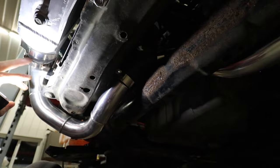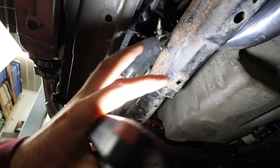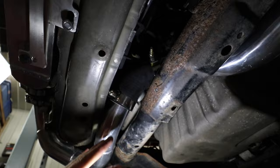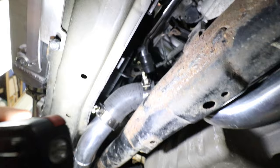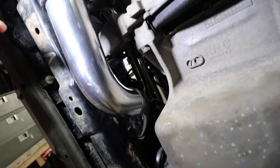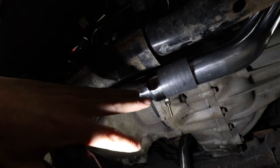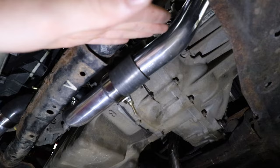Underneath on the passenger side, the pipe bends out from the intercooler, goes up to the frame, and bends up over the subframe bar - you've got a 2-inch T-bolt clamp there, then another 2-inch T-bolt clamp. Mock everything up loose first, then tighten the hose clamps to hold different pipes in place. The pipe goes over the subframe, then the other intercooler pipe comes up by the oil pan and goes into that 45-degree silicone coupler, then bends around the subframe to a straight silicone coupler.